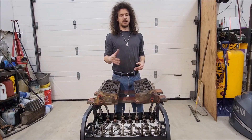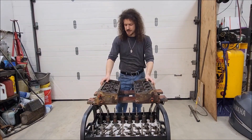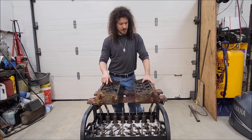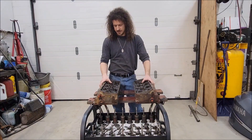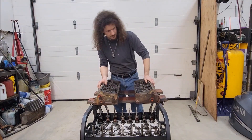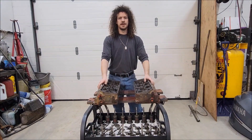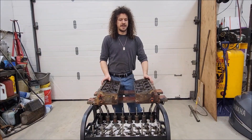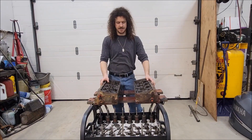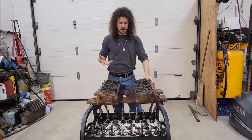The port polishing isn't something I know enough about to really record and teach, so I'll probably just leave that out of the video. I know I want to do that prior to going to the machine shop, just so I don't nick any valves or anything. I know the guides are also getting replaced. Going larger means the seats might have to be replaced if they can't be cut. I've never ported anything that's cast iron, so it is a little nerve-wracking. But you can't not do something just because you're afraid you might mess it up — that's all part of the learning curve. With the boat engines I have had some practice with cast aluminum, and actually had some success, so it's a good direction.